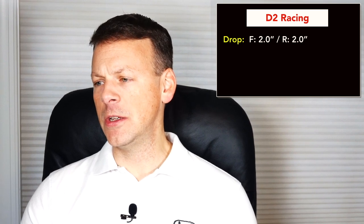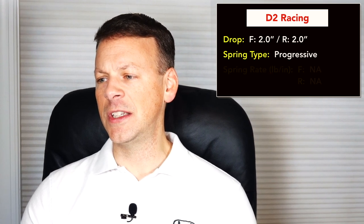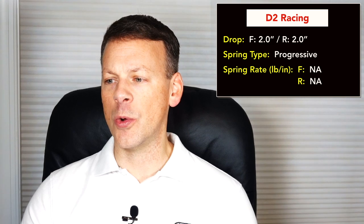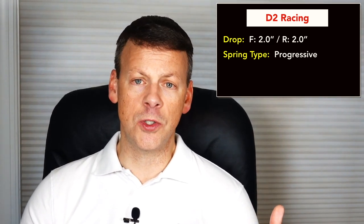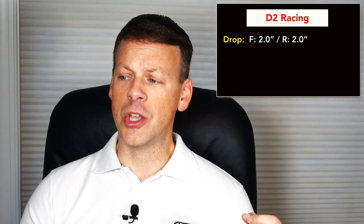As far as the spring rates, they did not quote their spring rates either when I called, but the individual did say roughly 20% stiffer than OEM springs. Which is interesting. That's not a lot. I mean, it should be noticeable. You should feel it, but not a huge difference. And if they are progressive, I like that. If you're looking for maximum drop, that might be the way to go.